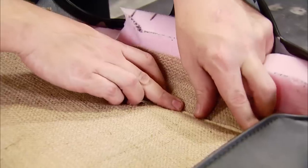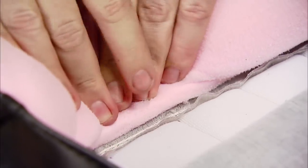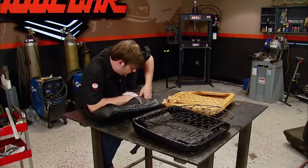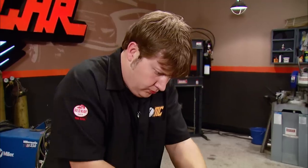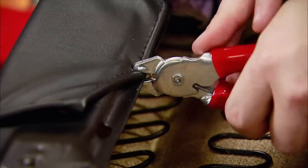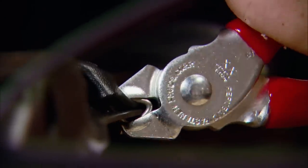Now we've got to hog ring these things together. You push the rod down onto the groove that we cut into the foam, then fold the edge up so that you can get that rod close to the one you installed into the cover. A hog ring and a pair of hog ring pliers will make them best friends forever. Recovering one of these things takes a whole bunch of pulling and tugging and grunting, so make sure when you run across one of these guys that do this every day, you show them some respect because it sure ain't easy. Whenever you pull seat covers tight, you want to try to pull it as flat as possible because some wrinkles can be massaged out, but if they're lapped over, it's just going to have a wrinkle in it.